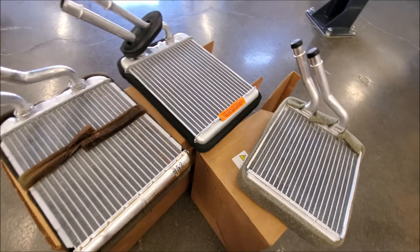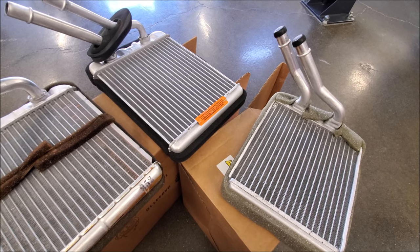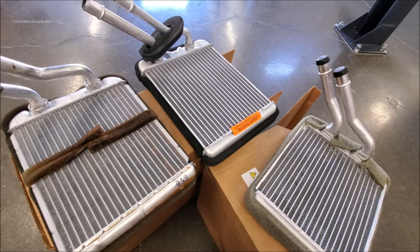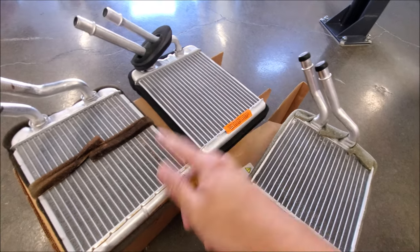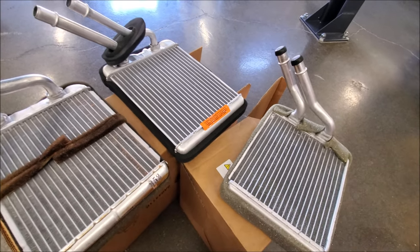These trucks actually come with two different styles of hose connection. The best thing to do is buy from your local auto parts store if you can, because I took this out and brought it there. If you are trying to save time, buy both styles, and when you can return one — take out the old one, verify which one you have, reinstall the new one, and then return the one that you don't need.